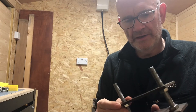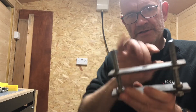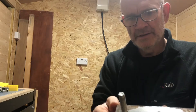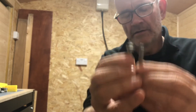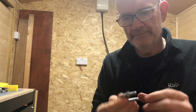So this was the metal thing I made to get the drive shaft out. It took two pieces of metal, three holes — one for the drive shaft and two for the threaded bar — and four nuts to enable me to press this upwards. Slip it over the drive shaft, use the nuts to pull it up. On the cable clips, I had to grind with an angle grinder the threads off on the inside of the clip itself, so I could slip it over the drive shaft without damaging it, but there was still enough thread left to screw it on. That's how I got this off. I've just got to work out now why I can't get it to spin the propeller or impeller correctly. Cheers.